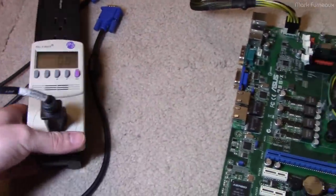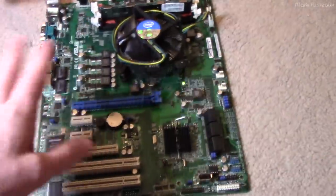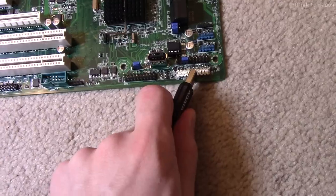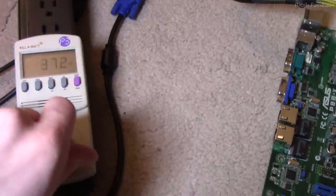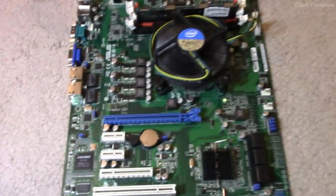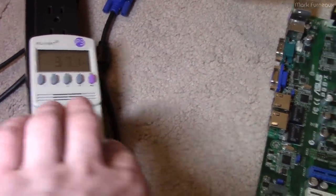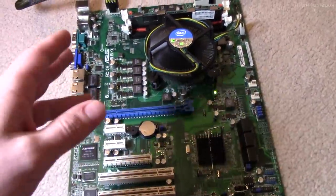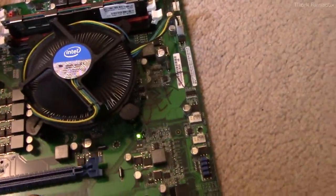I've also got a kilowatt meter on the power supply, so I can see if power is fluctuating or if the board is doing anything. I'll just short out the power pins. You can see it's drawing 37 watts or so, and it's not beeping, not doing anything. The fans are spinning, but it's not drawing any different amount of power. This board doesn't take very long to POST — it's actually a pretty fast-to-POST board for a server — and it's just going to sit like this forever. So I'm going to cut the power because it's kind of boring.